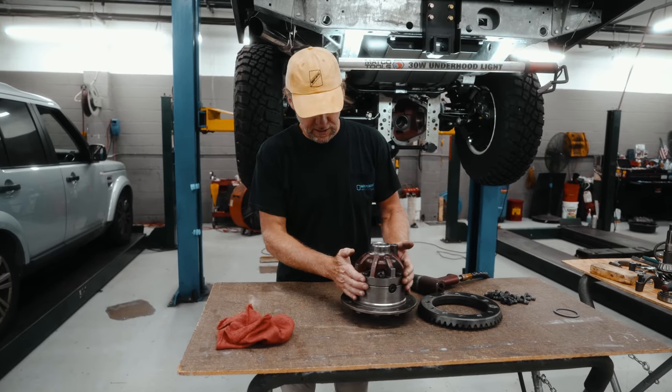So we're going to need to torque down the carrier. Carrier bolts are going to go evenly across. So, handy torque wrench. It's going to be 65 to 75 foot-pounds is the spec, so definitely get an assistant. I have Devlin here to help. All right, so easiest here is just get a nice straight bar. I've got a long wrench with a bolt through one of these holes. Your assistant can hold that, hold the carrier, and then we're going to go after it. Got it? Just wait for a click, and then we have to turn it around. It's also handy to have a paint pen, and then you can mark each bolt once you've torqued it down.